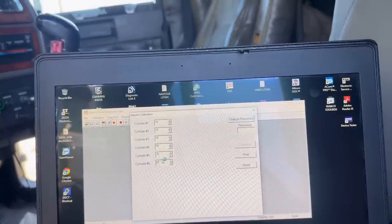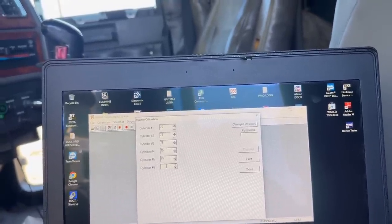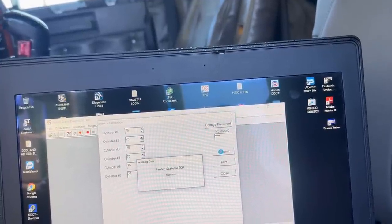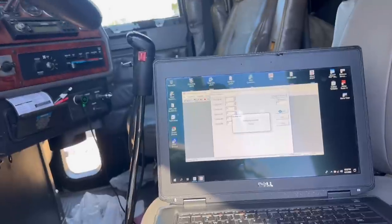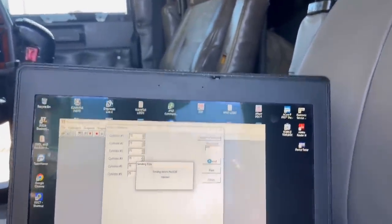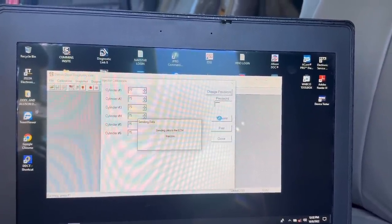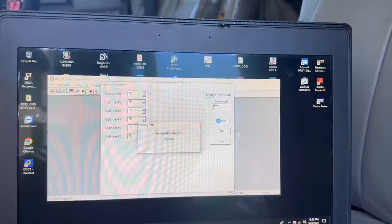So we're gonna go through and set all the trim codes the same and see if that helps it. This might fix it actually, because it has been tuned. I'm really hoping this helps it. If not, it's going to be getting a brand new set of injectors. Just a factory set. These are like a marine style injector, so they're usually a little sloppy anyway. But we don't want sloppy. We want fuel mileage, we want efficiency, we want all that.